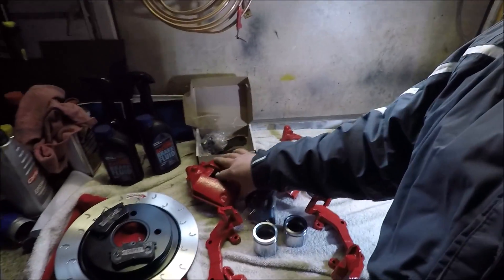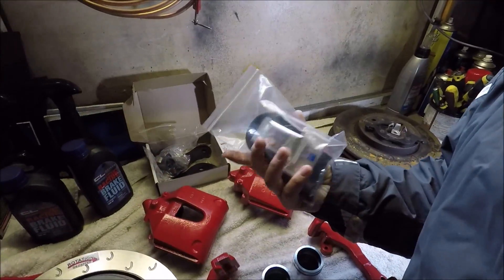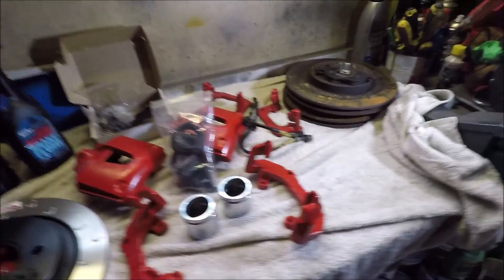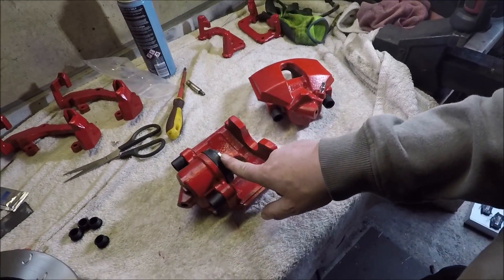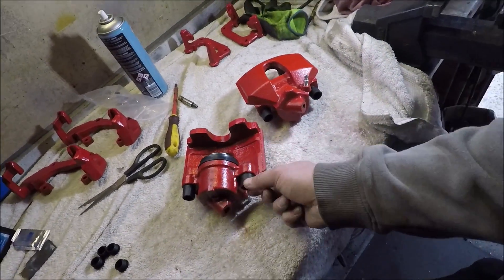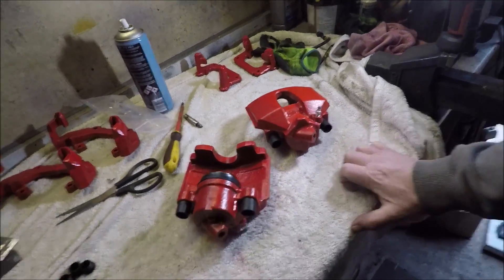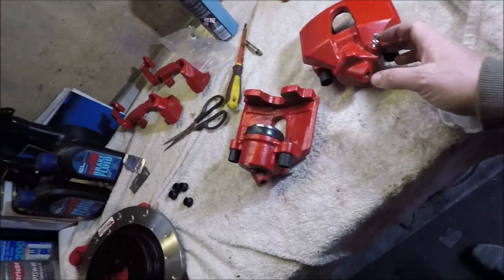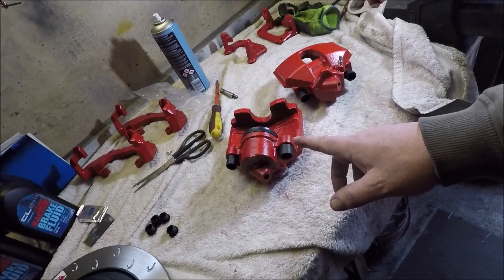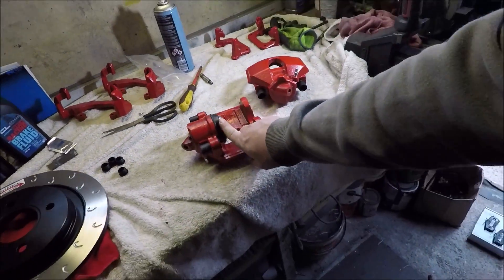The first thing I'm going to do is finish rebuilding these — I've stripped them down and painted them, not the best job but here's what it is. I've just rebuilt the calipers with the new pistons, new dust boots, rubber ring, new slider grommets and new bleed nipples. We won't cover that in this video as it's quite simple; there are plenty of videos on YouTube. These kits are about £40 from Godspeed — there'll be a link below to their website.